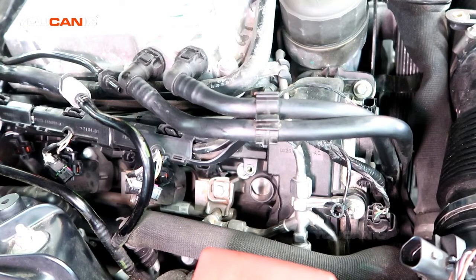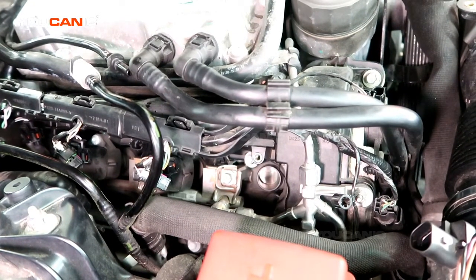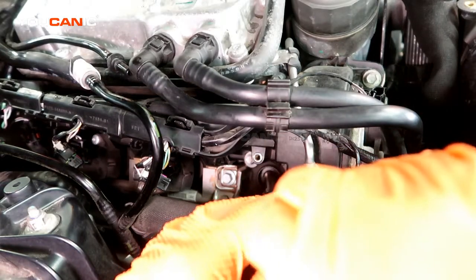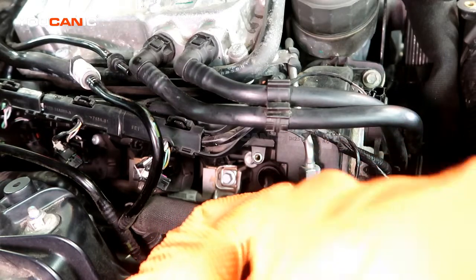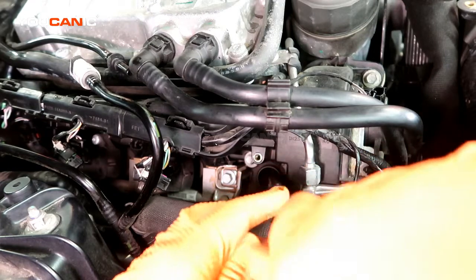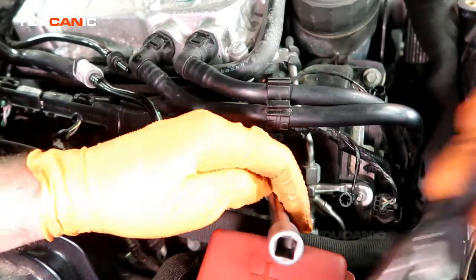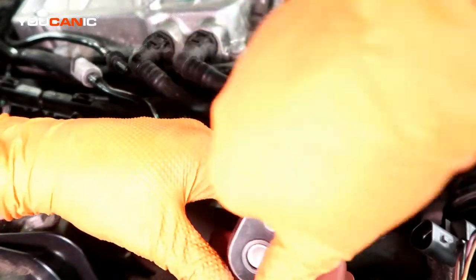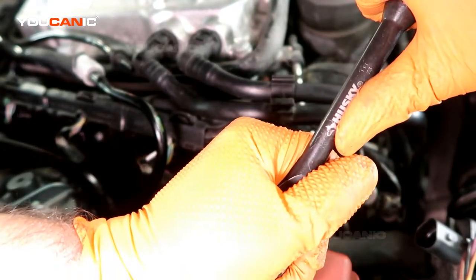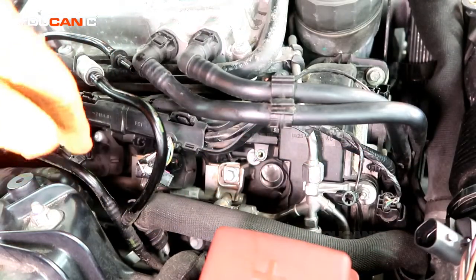A little carbon buildup is all. You've inspected the spark plug and everything looks good. Take the spark plug and guide it back in with your spark plug socket, start it by hand to tighten it. Then torque it to spec to crush the washer and seal it all off.